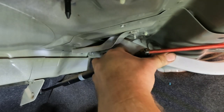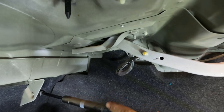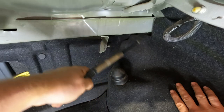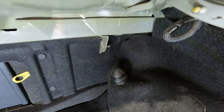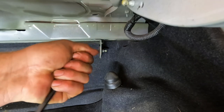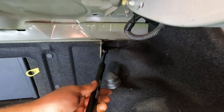Now we can pop the joint off. Same on the other end. What you can do is just pull the bolt right to the side and that'll pop off. With the new one it's just a matter of a reverse procedure. Make sure that's tight and push that bolt right on.